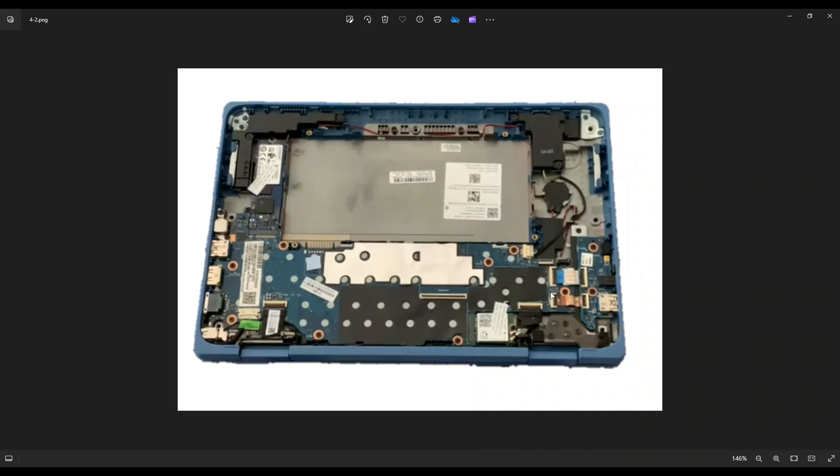As far as the RAM in this computer, if you notice there is no RAM here. The RAM is integrated into the motherboard on this computer, so there's no removable, replaceable RAM — it's just what you have on the motherboard. So if you did want to upgrade your RAM, you can't really do that as easily as we just upgraded the solid state drive. You would need to either get an external memory setup, or you would have to swap out this motherboard for another motherboard with more RAM if your computer did come with that option. First see if this model computer did come with that — if it did, maybe you can find a motherboard online on Amazon, eBay, something like that. If it doesn't come with a higher RAM option, then your options are limited and you probably can't just replace the motherboard.